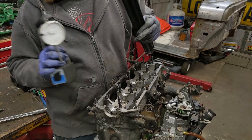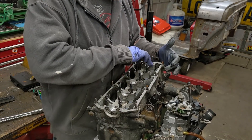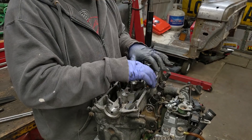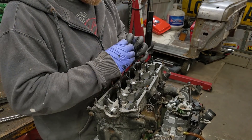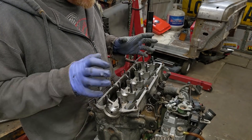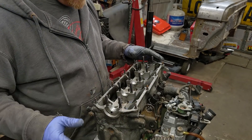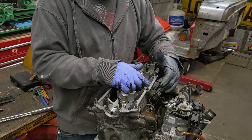We're going to use oxy-acetylene — I don't think propane or MAP gas would work, you've got to do oxy-acetylene. We're gonna heat it up at the top. When you heat it and it cools, it contracts. The top is under a ton of tension and will relax and pull in. The bottom has been heated and cooled its entire life — that's caused it to contract, pulling out on the top and creating this banana shape. We're just going to equalize that by heating up top.